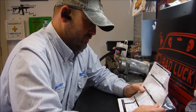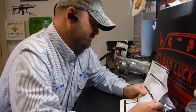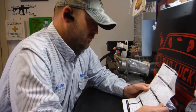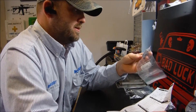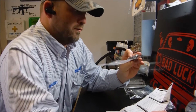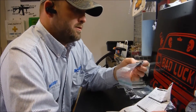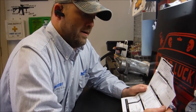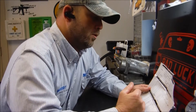I'm baselining around 63 pounds for these injectors, which is awesome. I mean, these started life as 25.2 pound injectors — they're out of a 2006 LQ4. So they went from a little over 25 pounds to being basically 63, 64 pound injectors. But I was prepared for one to flow quite a bit more than the others.